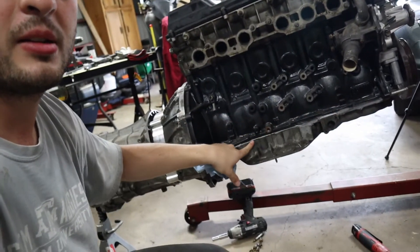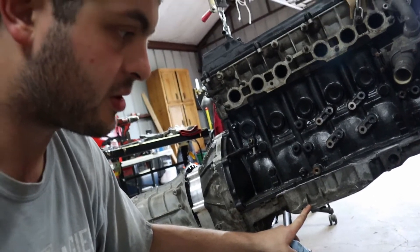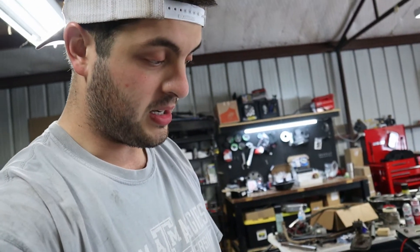I don't have to take off the entire oil pan because this right here is where our flange is going to go. It's OEM — it's meant for it. They're just not drilled out because it came off of a non-turbo SC300. I took the bottom part of the pan off, which took way longer than expected. I can definitely access behind this and I'm just going to stick my shop vac and air compressor up there to get all the shavings, which is going to save us a ton of time. Since the engine is out of the car I have access to everything.